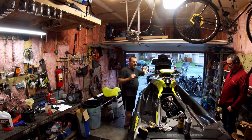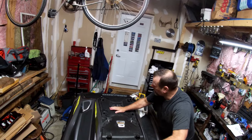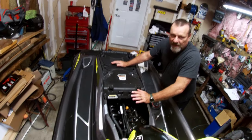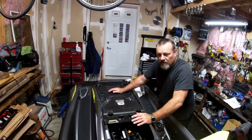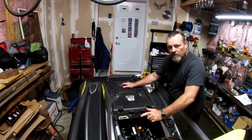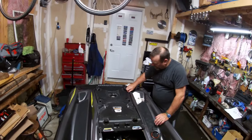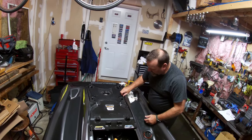We're done — it's done for the winter; it can sit outside in the cold now. We've left the battery in this one. We have access over the winter so we'll throw it on a charger a couple of times — I'd much rather charge it for 12 hours twice during the winter than use a tender, since tenders tend to overcharge. Get all the bolts back in — just start them, make sure they're biting. These things will pop through and fall in the hull if you get too crazy, so be patient.